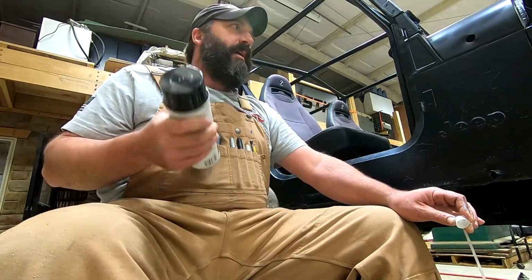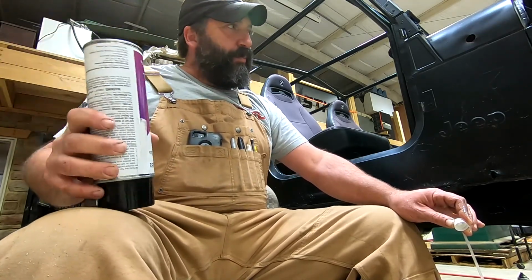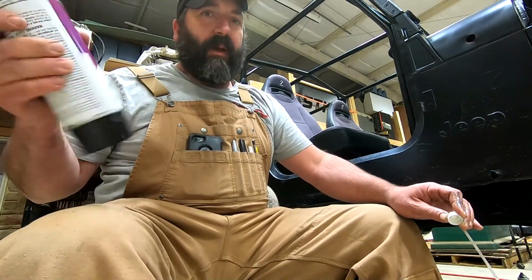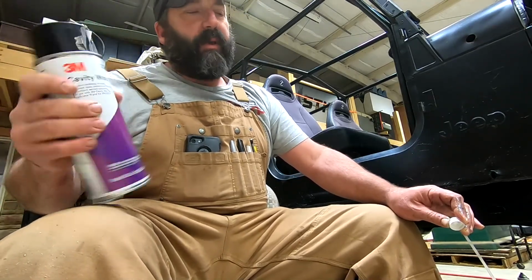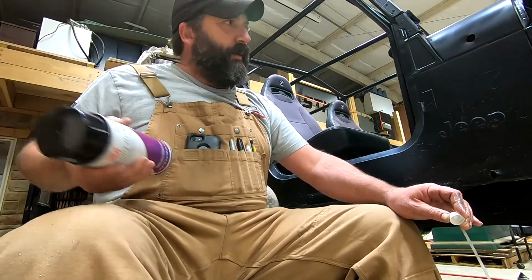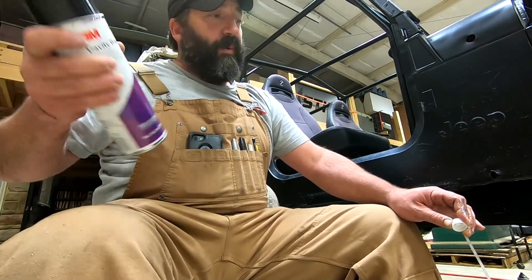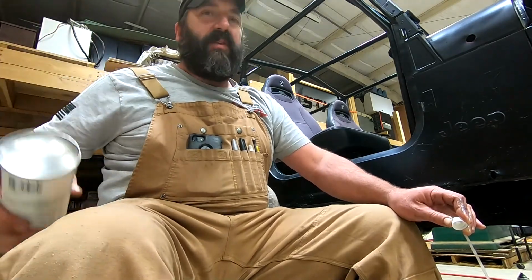I guess last fall. I took the Jeep down to the shop and ran a pressure washer through all the holes and just blasted and blasted and blasted every frame hole in it till nothing but clean water came out. Then I took it in the shop and ran a blow gun through it. Got a Snap-on or Blue Point blow gun with a little rubber tip, put it on the air hose, and blew all the moisture I could out of it and let it sit in the shop for about 2 weeks.